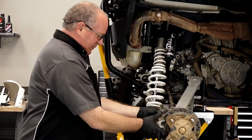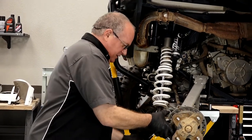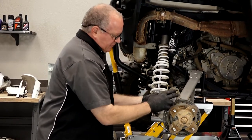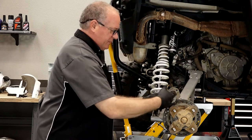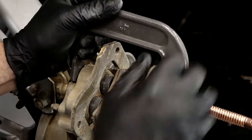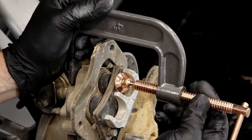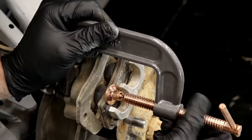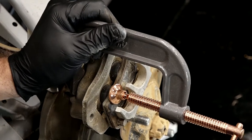We've got it cleaned up reasonably well. Go ahead and finish removing these bolts. Next, what we need to do is grab a C-clamp and we're gonna use it to compress the pistons back into the caliper housing. You'll have to move it back and forth from one to the other to get it to go back all the way. You definitely want to do this with the old pad still in there so you don't damage the edge of the pistons.